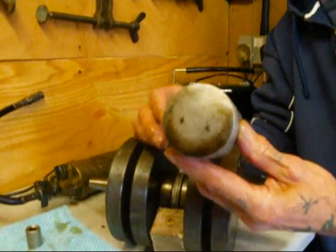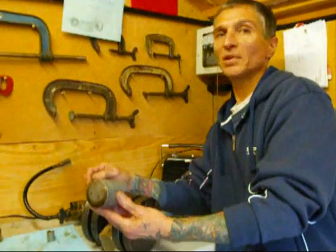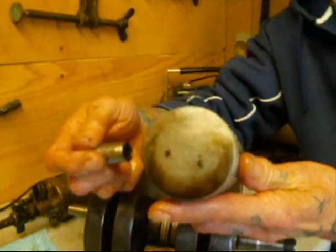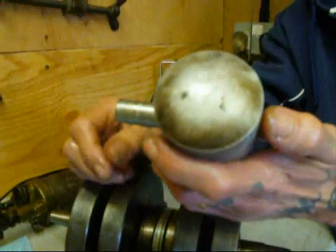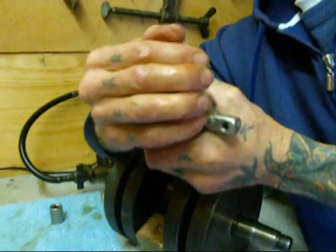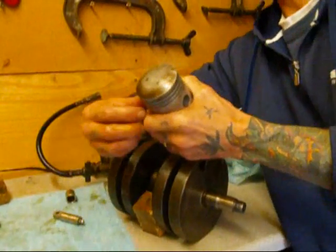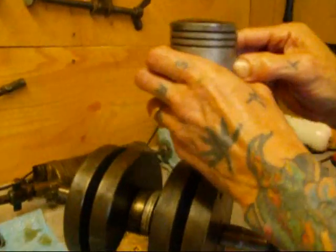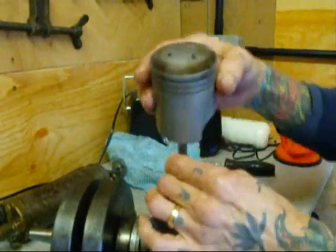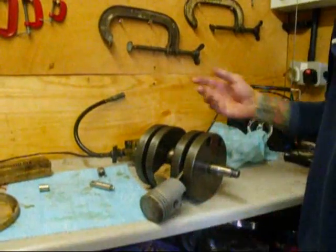So is it like a three-part manoeuvre? Well, it is if you include putting the gudgeon pin back in. That's the third part. Right, so we've got the gudgeon pin, and as soon as that's in there, that's your loose rollers done. Back in. There we go. Take it away. Push the gudgeon pin in. Get the circlips in, because once this piston cools down, you won't move that gudgeon pin. All assembled, done. As it was meant to be. Connected, no problem.